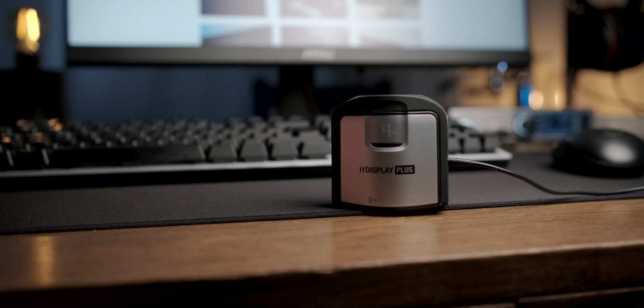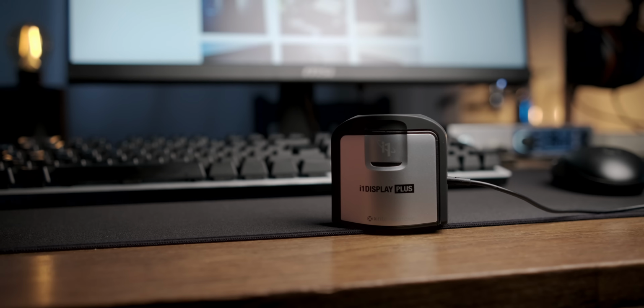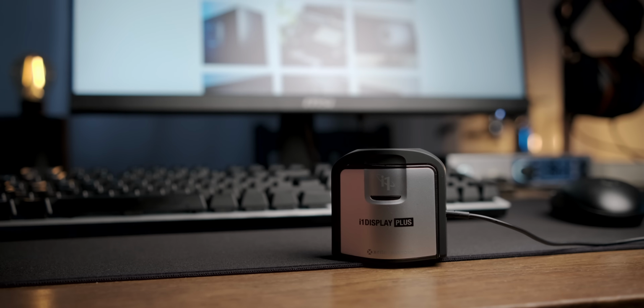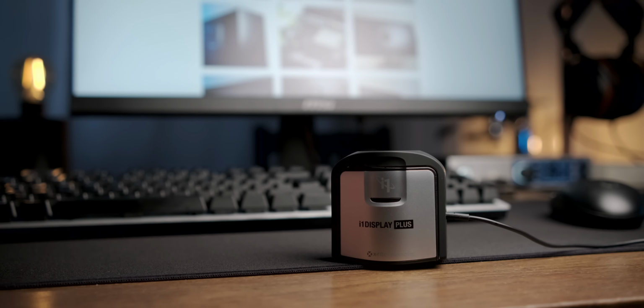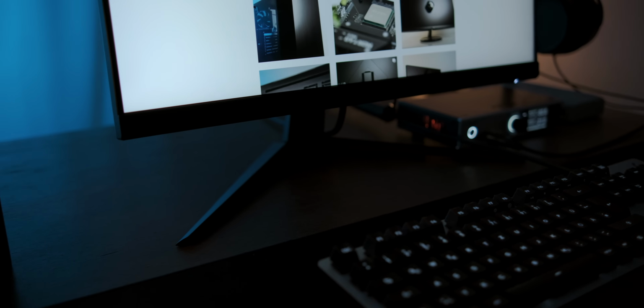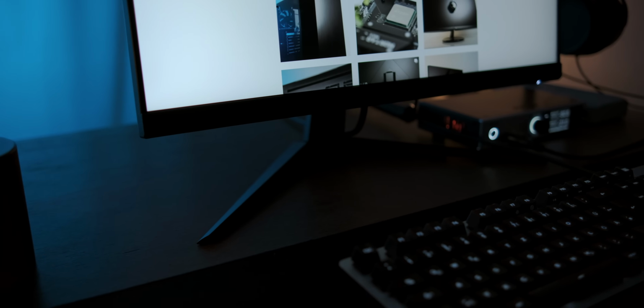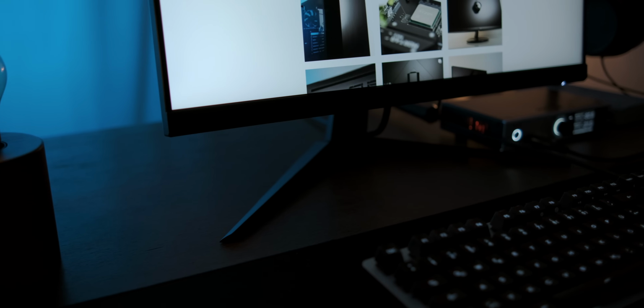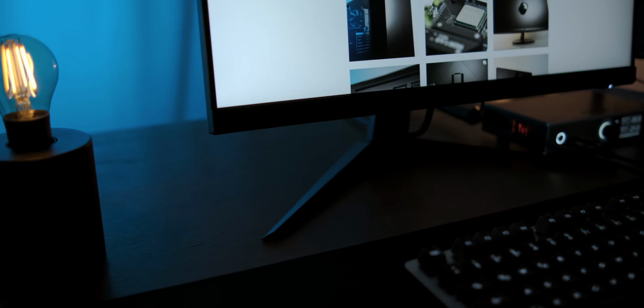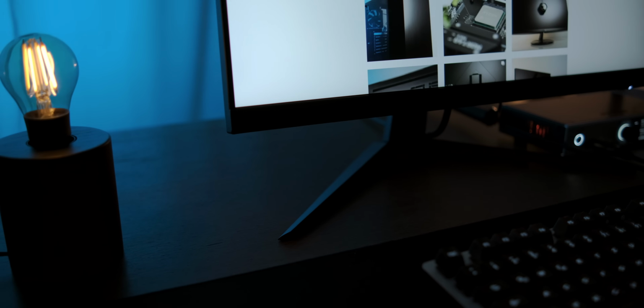This is the highest contrast I've gotten from an IPS panel so far, and it's even in arm's reach of lower tier VA monitors like the MSI G24C4 for instance. Therefore, the G241 handles dark scenes in videos or movies pretty well, and I enjoyed it quite a bit more for that purpose than I would have thought. This obviously is not pitch black OLED level performance, but basically as good as it gets for a standard IPS monitor.